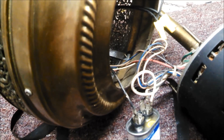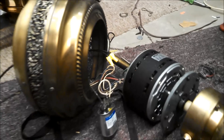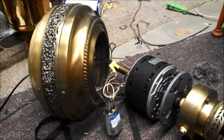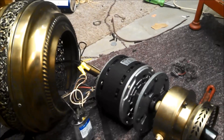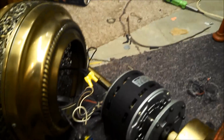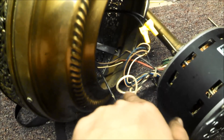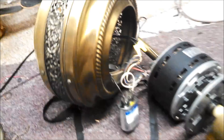So what I did is I wired the four in, plugged it in, checked it out, and it still was doing the same thing. I said to myself, there are only a few things that could still be the case — because if it's not the capacitor, it's either one of the connections to the capacitor or one of the motor coils. The motor coils are very unlikely unless there's physical damage or it got burned up, and neither of those seem to be the case. So I traced all the wire leads from the capacitor.